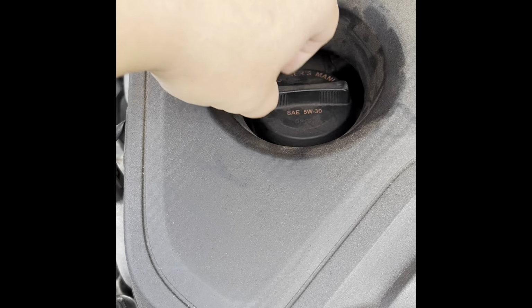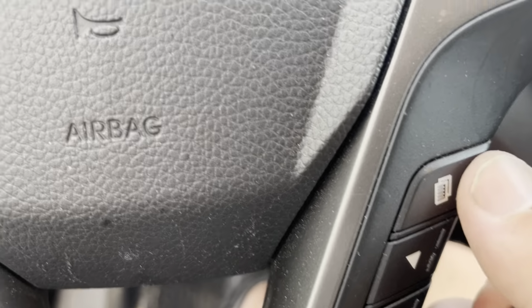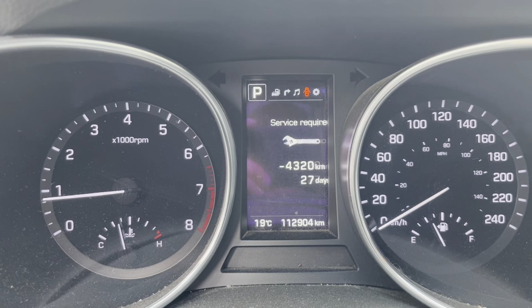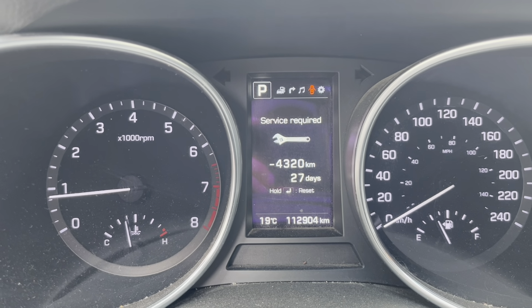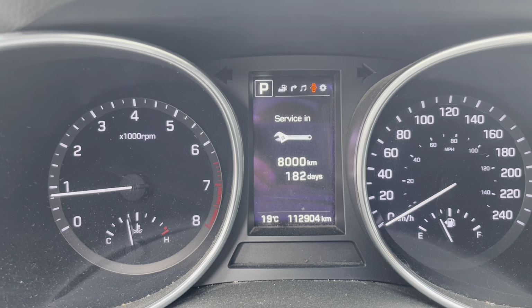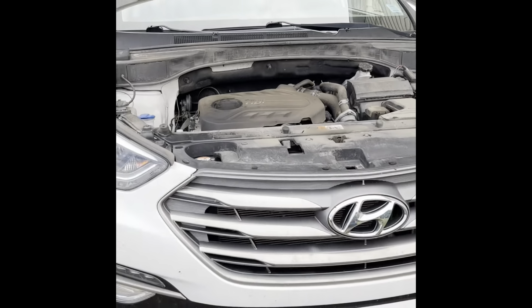And then in order to reset the oil service light, you're going to go into your car and using the scroll button, scroll until you see service required. Then you're going to hold the back button to reset your service interval. So that's everything you need in order to change the oil and filter on a 2018 Santa Fe. Thanks for watching.